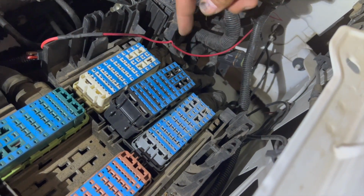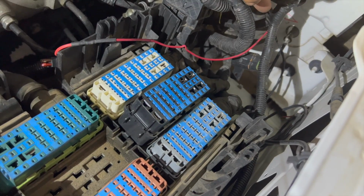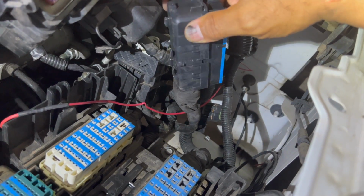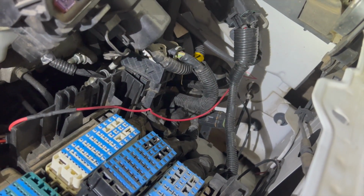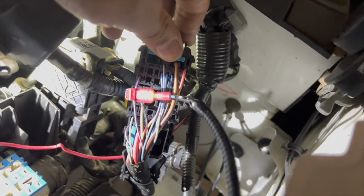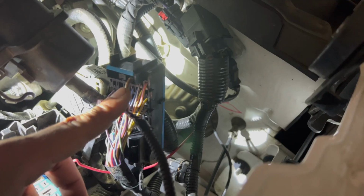I'm assuming that this connects to the same black connector that we just messed with in the block inside the truck. We're gonna unravel the tape that's right there, and we're gonna start tapping into some wires on the back side of here. We've tapped K6, the wire coming out of port slot K6. We are now going to run that back into the cab. So we're gonna put the cap back on this, tighten it all back up, make it look nice and neat.